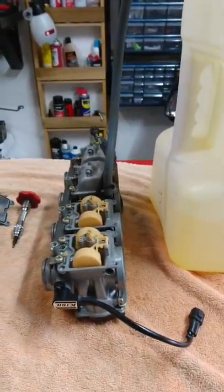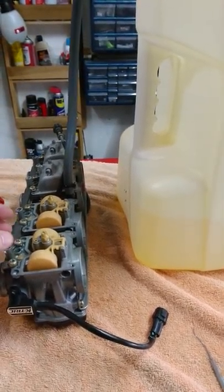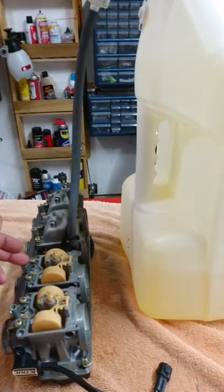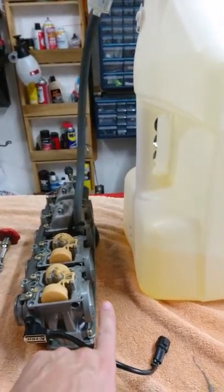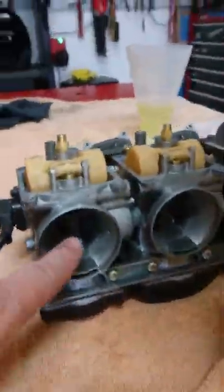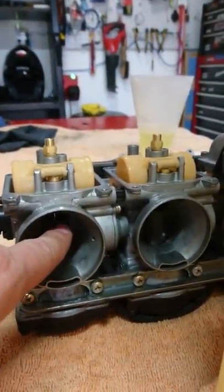This is to show how number four continues to flow fuel. We have our gravity feed here. This is cylinder number three. In the previous video, you could see how the bell housing was all wet and there was just a little bit of fuel coming up from the jet needle, which is that little piece standing up in there.